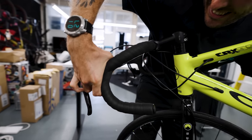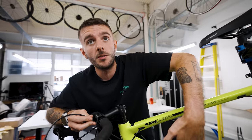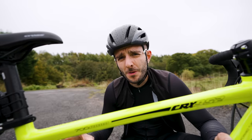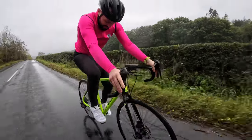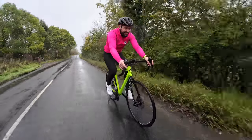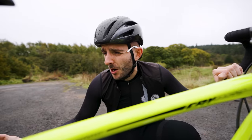The reason I don't like triples, especially cheap ones like this — there's just so much tension. You need to push so hard to change gear, not helped by having to run a massive outer cable all the way through the frame because they've made it internal. But it does work — just not nicely. You're going to end up with more gears than you would on a compact using a triple, but there are loads of overlapping gears, and this has always been the issue with triples. When you're cross-chaining — in the big chainring at the front and a big sprocket at the back, or the little chainring at the front and the little sprocket at the back — you're putting loads of unnecessary stress on your chain and drivetrain, so things wear out quicker.